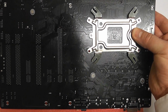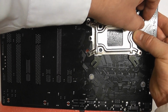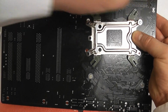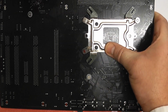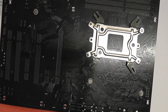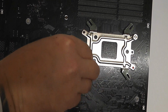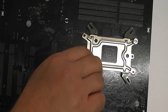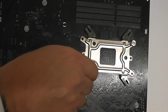Now you need to put the nut onto the bottom, okay, and there's your nut. And then you just need to tighten this up finger tight, and then use yourself a little adjustable spanner. So we'll just get that set up just right, like so. And again, you want to try and do these in a sort of diagonal motion here rather than working round. Just going to offer this one up and tighten this one up. Now again, we're just going to put these on as finger tight first, and then tighten these up with an adjustable.